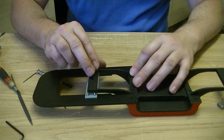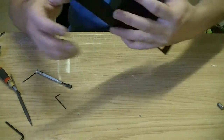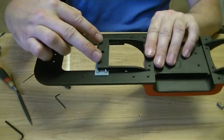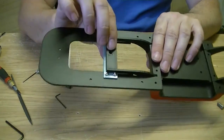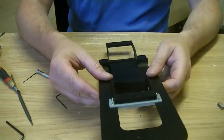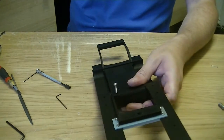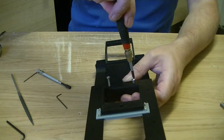On your kits, let's say there's two bolts either side. There'll be two countersunk bolts which you push through there, and two nuts will sit on the top of there, which will hold that stronger. Mine hasn't got it because I didn't think it needed it, but I was wrong. So what you do now, just get your two bolts into the middle, bolt them onto the carrier frame.